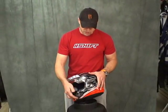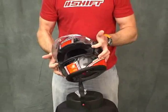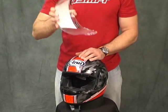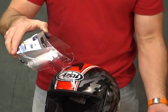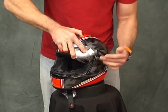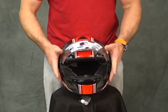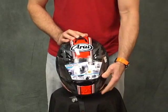You'll see there's a little tab on each side with a small arrow on it — you need to pull it up. I'm going to grab both of those with my index finger and pull them both up at the same time. You can feel them release; they're pulled all the way up against the shield. Then grab the shield dead center at the top and just pull it right off — don't hesitate. To put it back on, there's a clear cutout in the shield that goes into a pivot just underneath the side plate. One side at a time: dip the shield in, push back — very positive engagement. Repeat on the other side, then push the shield down. You're done.